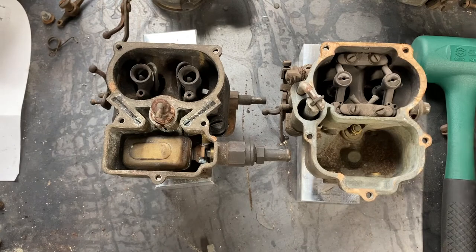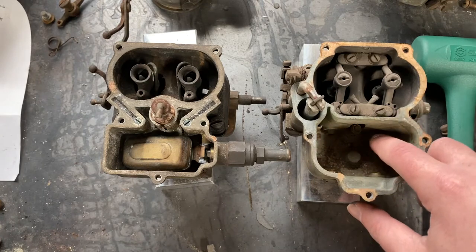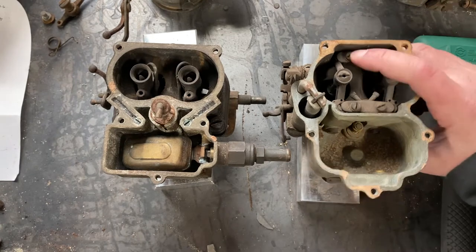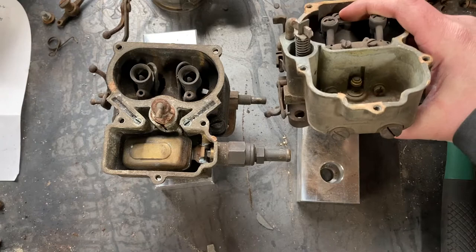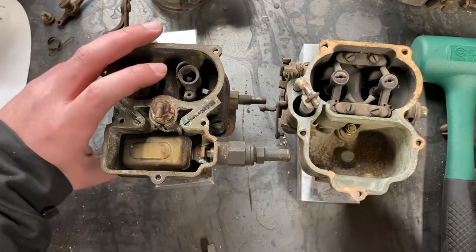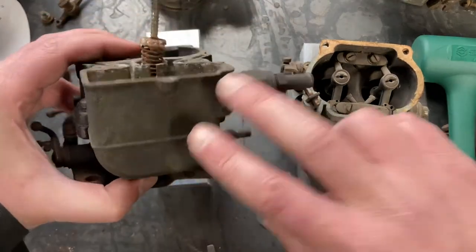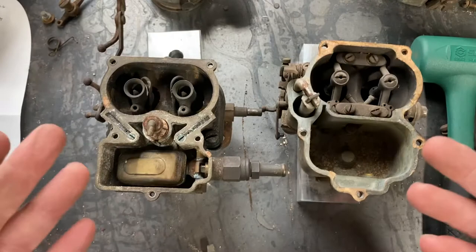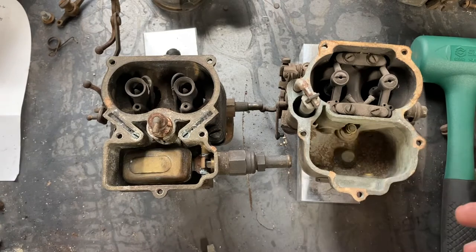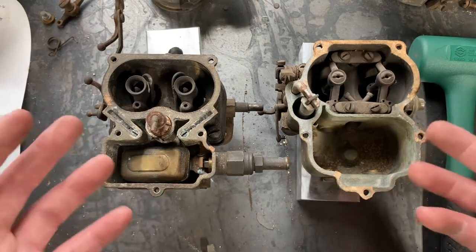Another compare and contrast between the two carburetors is the main jet location. On the Holley, the jets are inside the bowl right up against this wall, and you have to access them through these screws on the side of the bowl — you use them as a drain and insert your screwdriver to remove and replace the jets. Whereas on the Stromberg, they are external and you don't have to remove anything to get to them. There's still a pain to get to, but in a multi-carb scenario you can get a 90-degree screwdriver in there if you absolutely had to. So there's no better way in terms of the two, in my opinion.